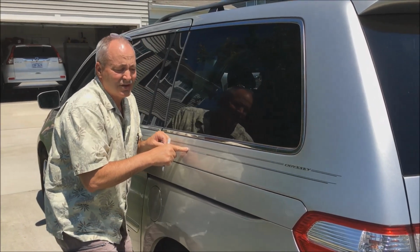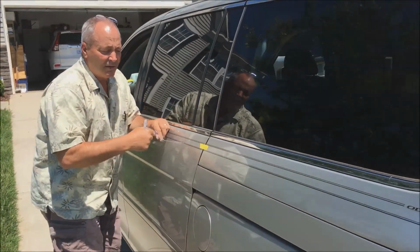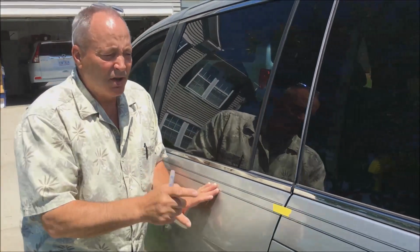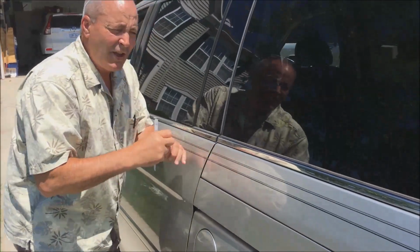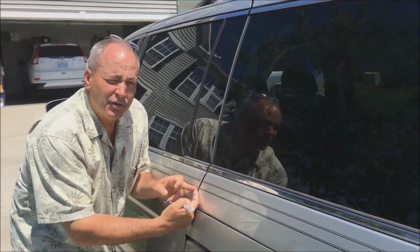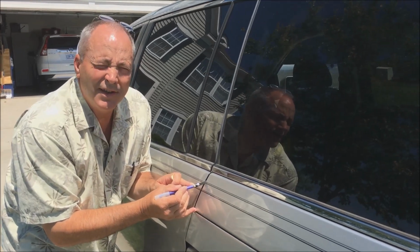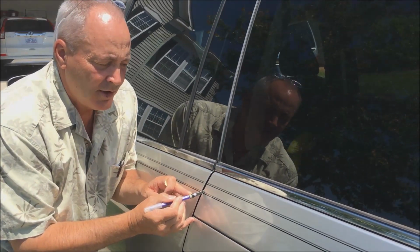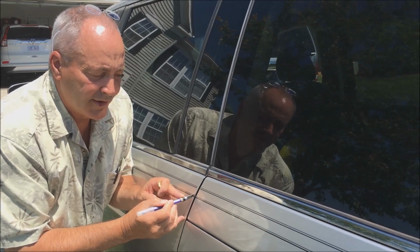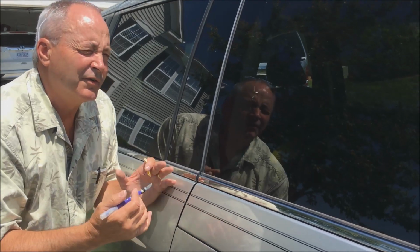You do about 6-8 inches at a time. You're pressing down, okay? You're coming down like so. That's how you do it. Okay, now when I come to trim, you take it off the whole vehicle. When I'm trimming between two panels, I usually come in about 1/8 inch, 1/16 of an inch, okay? And I either roll the blade like we talked about, or click, click. You can feel what the blade's doing through the vinyl, so you don't have to cut the paint.